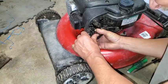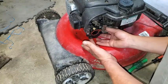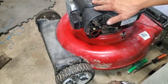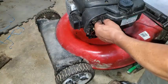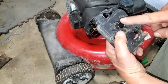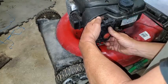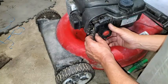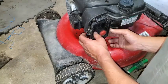Get this lined back up with the manifold inlet. Jimmy it around a little — there we go, got it on there, slid right on. Everything's in place. Now you might have to take this cover off unless you can get lucky, because you've got to get this little breather tube on the back side of here. Make sure to put that little breather tube on there — sometimes you can get it on fairly easy. As you're positioning this back in place, make sure it doesn't come off.